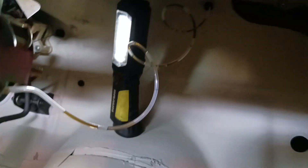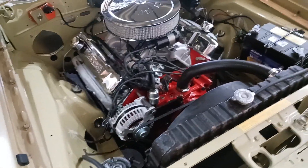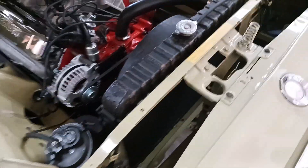You'll also want to leave some loose coils underneath — that offers flexibility in that line. And the last thing I can point out is you'll notice there's air in there. That's fine. It doesn't matter that there's air in there and you're wasting your time trying to bleed it. It still exerts the pressure on the gauge — it's a mechanical gauge, it just needs the pressure. So don't worry about air. It's a closed system. If you somehow even did manage to get it bled, you'd come back in a day and it would need bled again. You'd just be wasting your time.